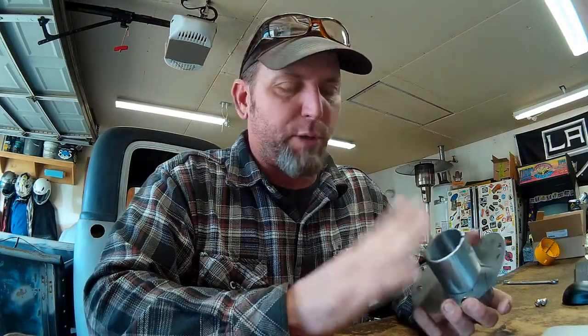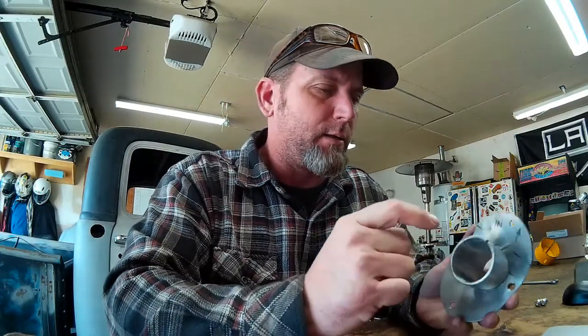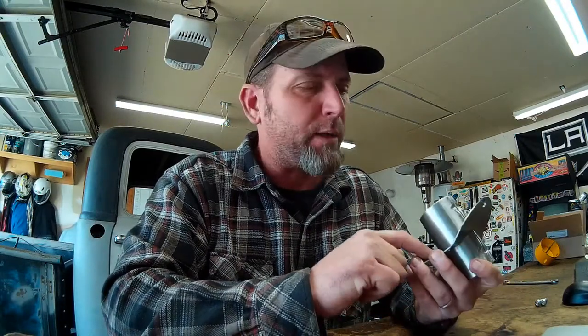So that's how that works. I'm going to bolt all this into place with some non-stainless hardware so that I can tack it so that the stainless doesn't gall and stick together when I tack weld everything. I'm going to put it all in place on the firewall, get the steering column and the steering wheel in the right position at the right angle that we're looking for, and then tack the sleeve - the pinch sleeve - into the foot plate that mounts in the firewall. Remove it all and then fully weld everything with the TIG.